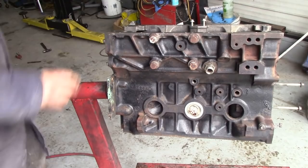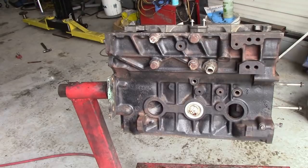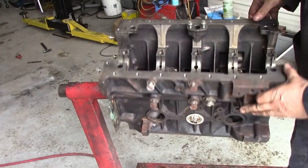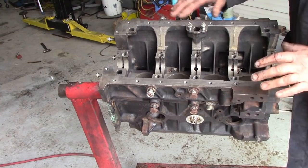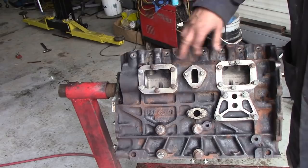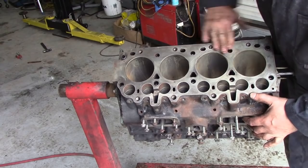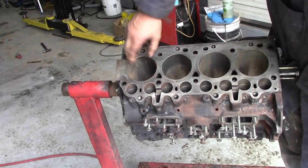After a good steam cleaning, I washed it off with auto engine and machine cleaner - it comes up really nice, gets all the grease off and all the rust. Look at the difference inside the block. It's got just a light surface of rust but the block is hot from the steam and there's no oil or residue on it - it's really super clean. I've blown out all the holes, so the next thing is to give it a coat of paint. As soon as you've got all the grease off, it rusts up straight away.